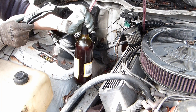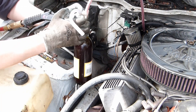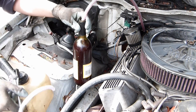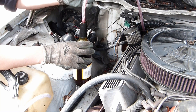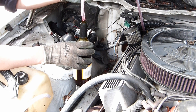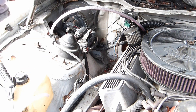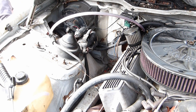The reason we put the inlet hose lower than the vacuum hose is so that we don't accidentally atomize any of that oil and spray it around on your car or breathe it in. You want that little offset between the vacuum tube and the inlet tube that is drawing the fluid in.